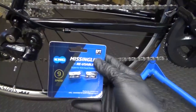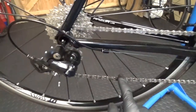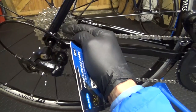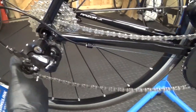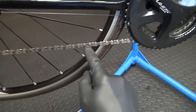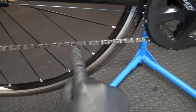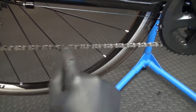So to fit the missing link to your chain, first thing to do is select the lowest sprocket on the back — your 11 tooth on the back and your smallest at the front — just to allow so there's not so much tension on the chain in this position before you start.